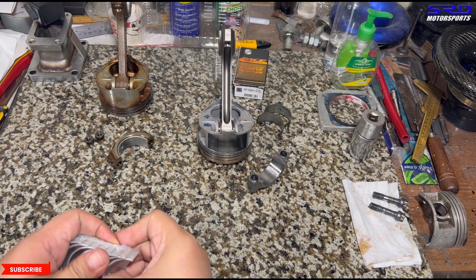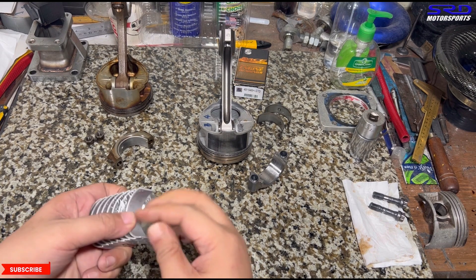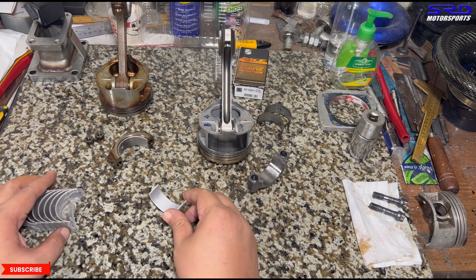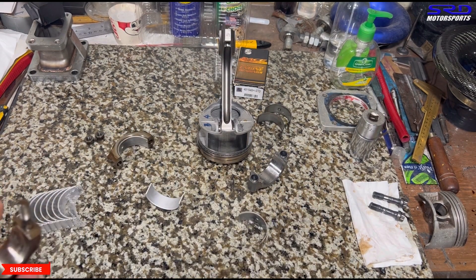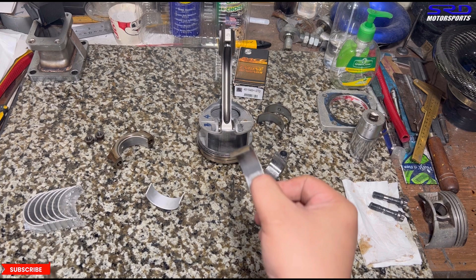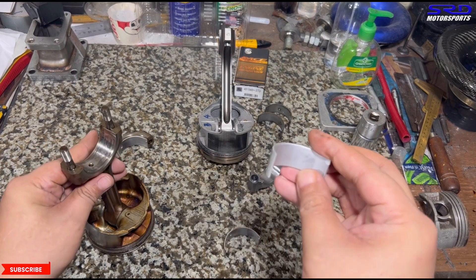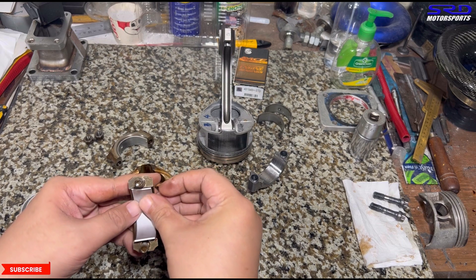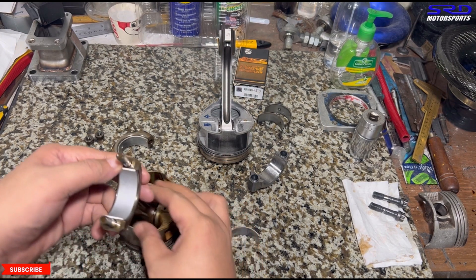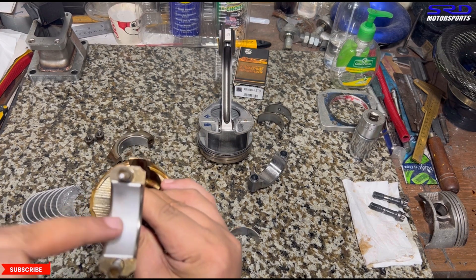The plastic wrapper on the OEM bearings is always too thick, but we can't complain. Now, compared to the B20 bearing — if you use the B16 bearings on the B20, it's not just the oiling you're reducing on the skirts and underside of the pistons for cooling, but you're also restricting flow. If you restrict the connecting rod bearing oil exit, the main bearings have a hard time flowing into the rods, and yes, that may cause your spun rod bearings.